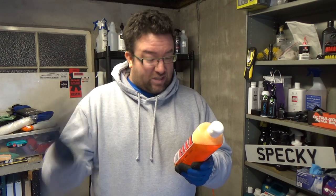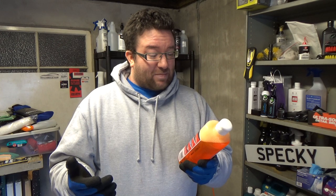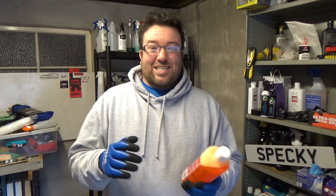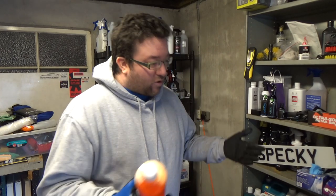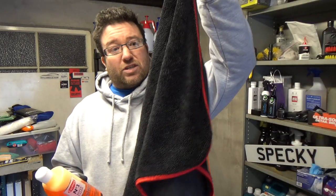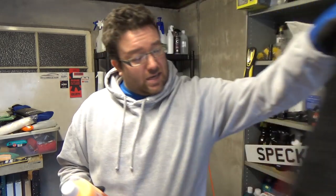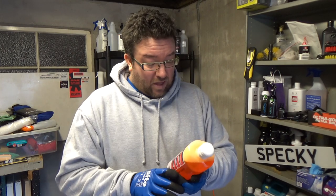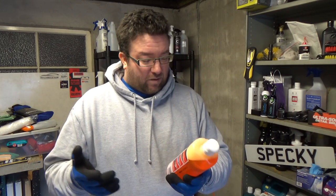Please stop telling people to use sponges or brushes. Wash from top to bottom — that's fine. Rinse with clean water — that's fine. Then they say use a chamois — don't use a chamois either. Use a good drying towel. Drying towels can be had relatively cheap; you can get decent ones for about a fiver, and they'll do a decent job. Use a drying towel, not a chamois. Otherwise, that's about it — then add a layer of Number One Super Gloss.